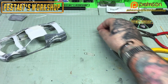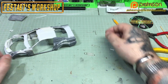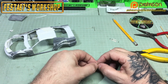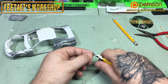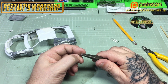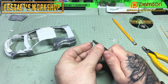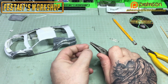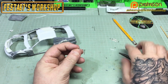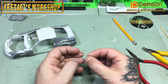So that's what we want to do. Looking at that, on this particular one because it's got the suicide-side doors, I'm also going to make one out of a skinnier piece because I have a feeling that on my particular build I might be able to get away with a thin one. So I'm going to do the same exact thing — pliers, go for a bend out, and then go for a 90-degree bend down — to make that shape. And that's your door hinge.